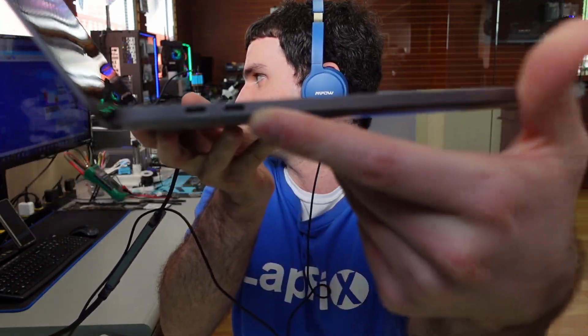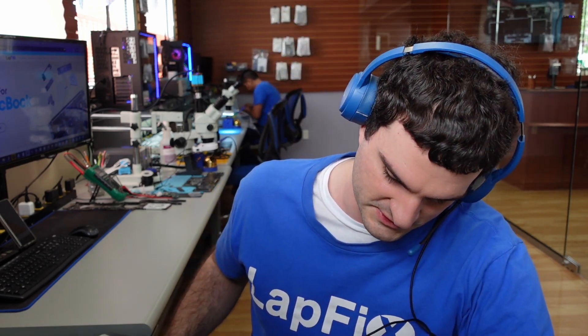Since we have Apple Configurator open, we want to use our Thunderbolt cable. Now, this is going to be different for each Mac depending on which one you have. I have an older Intel-based Mac, and there's something about which port you actually plug it into — it actually does matter. Trying to revive a 2019 model, the master port on these ones is going to be the lower one down here, the one closer to the trackpad. That's going to be the master port for this one, as well as the port for connecting to our patient MacBook.